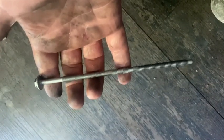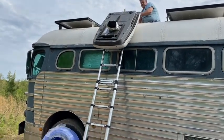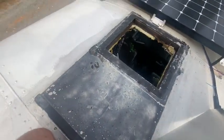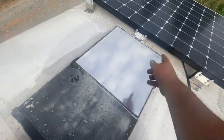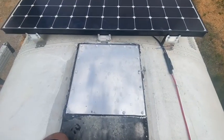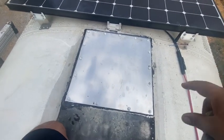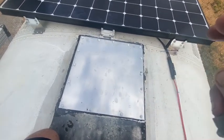These are super long screws — you definitely need a power tool. You can see how long they are. Lenny has these raised platforms that mount the air conditioners, and this is the piece I just had made today that's going to go on there with some self-sealing screws and a bunch of silicone around it. There is an elevated platform here that'll be a little bit in the way. Roof hole is patched. These have little sealing washers on them like metal roofs, plus it's got a big silicone bead on the underside and around the outside edge, so it shouldn't leak.